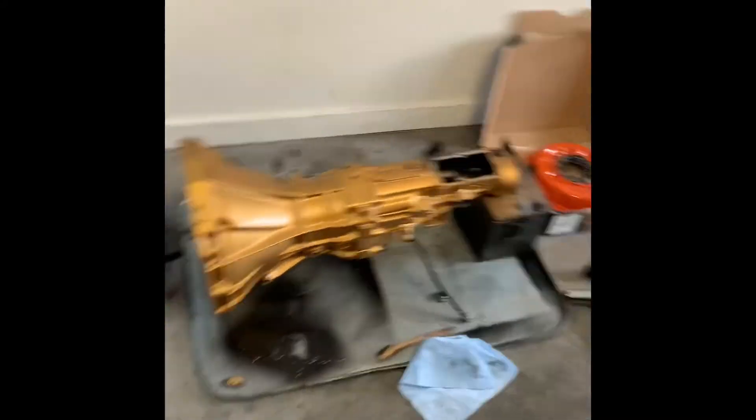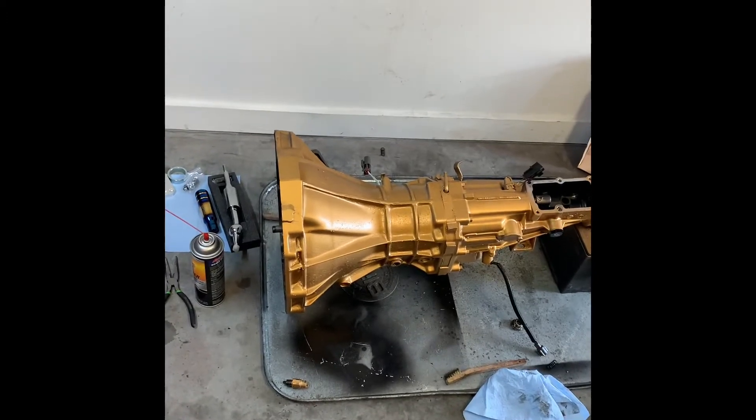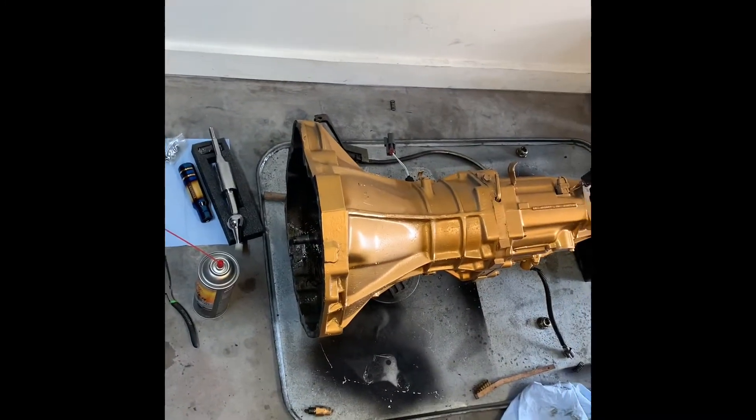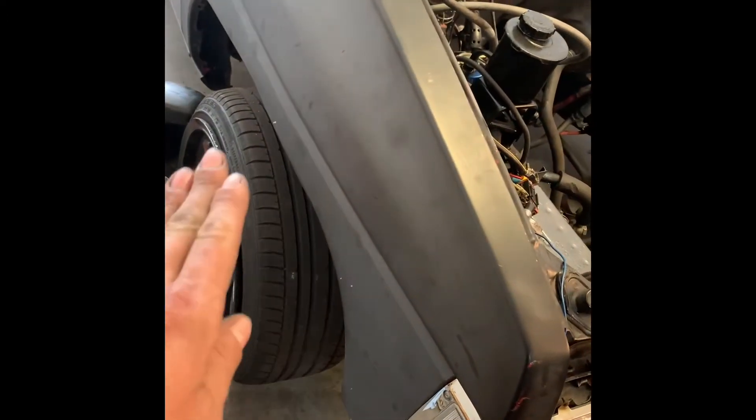It's a pretty sweet little truck — I love it. It's got a little duck bill on it. I'm going to get the engine off the stand, set it up on the ground with some wood blocks, put the flywheel on, put the clutch on, clean the rest of the trans. I'll probably start the next video out when I actually have it in and hooked up. I've got some more work — sway-away torsion bars, re-indexing those, dropping this thing a little more. I'm trying to tuck the tire on the front — I've got 17 by 9s, I think 205/40s.